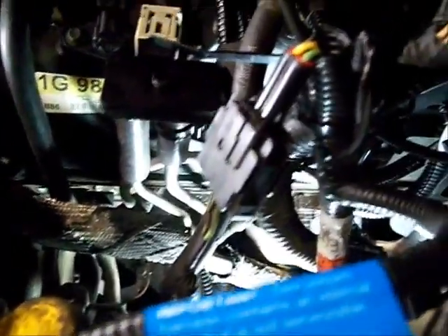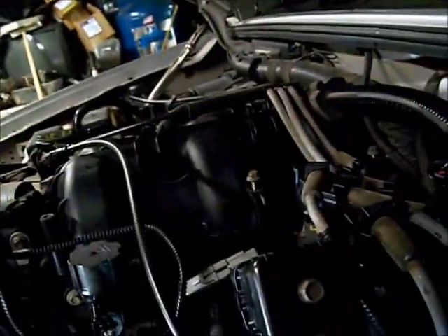I went ahead and marked the coil, even though it's clearly marked on top of the coil which plug wires go where — it'll be alright for faster reference. I'm taking this bank's plug wires off; they're all down this side of the coil. I'm leaving the other plug wires on and just taking the whole coil and setting it off on the passenger side.